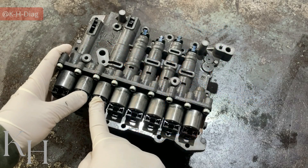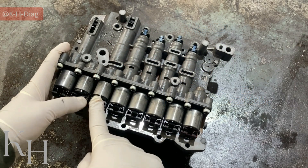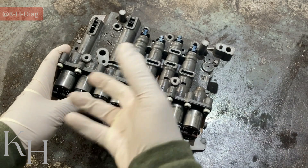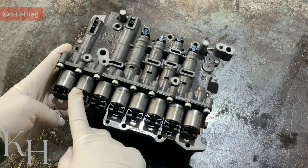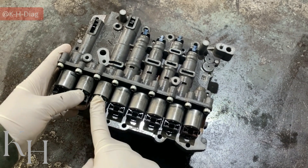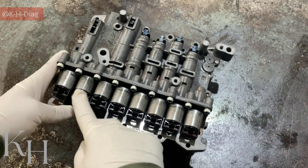The other two are actually on-off solenoid valves — they are either on or off. They are both normally low, meaning when the solenoid is activated it provides oil pressure. This one is called SSA, or shift control solenoid valve A, and this one is shift control solenoid valve B — just in case you have any specific fault for each one of them.